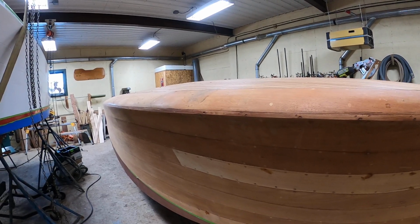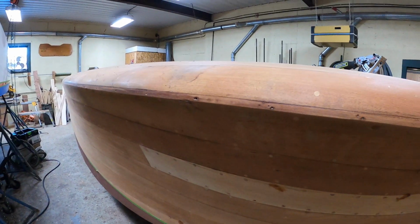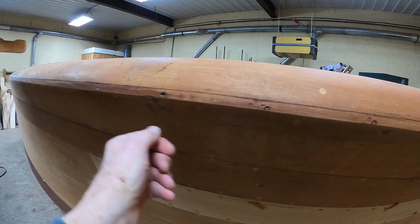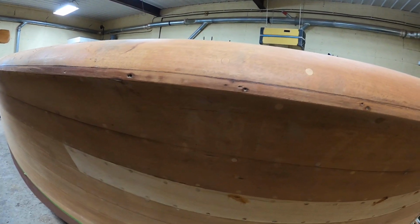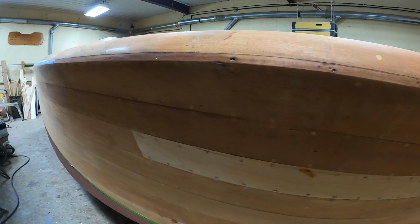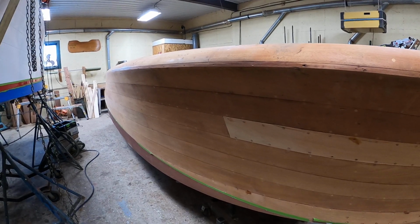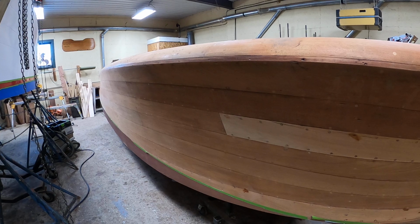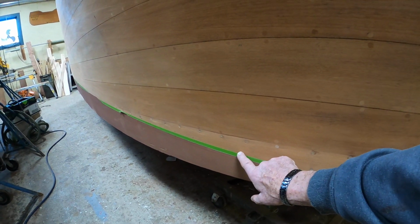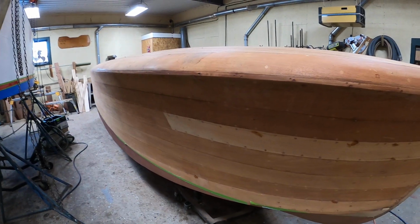Another very critical bit of guidance. Most people, and it would be natural, get my bleach, set it up here on the deck, get my chip brush and start swabbing it on, and you know what happens. If you want a boat with stalactites and stalagmites that are pure white that you can't get rid of, I'm sorry, you cannot remove them. No, you want, when bleaching, to start down here. It may be counterintuitive, but that's what you want, and that's what we will be doing.